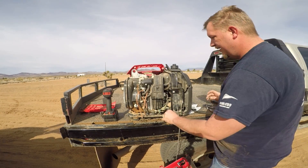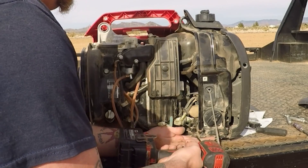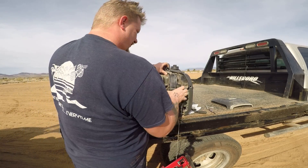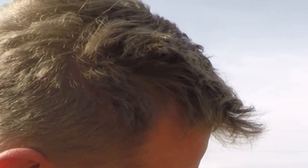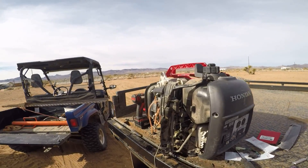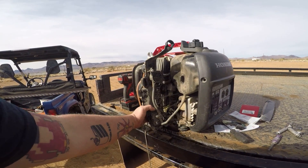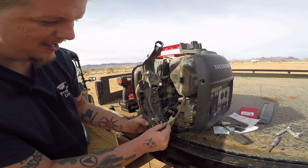In order to actually get to the switch, we got two Phillips at the bottom here, one right here. That piece broke off — it should not cause too much of a problem. Now this piece will come off. In order to work on it a little better if you needed to completely remove this piece, right here's your fuel pump. You can disconnect these and pull it all off, but since we have access to the part we're working on, we can see this is dirty — blow out your machines. What happened was it got a little wet or muddy down there and this piece is sticking.